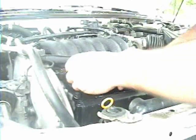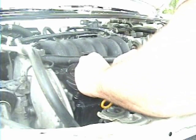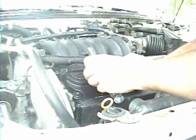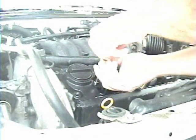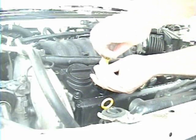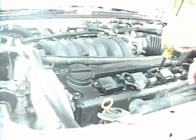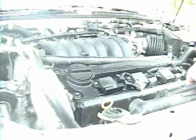So you just go ahead and after you place the spark plug, stick your coil back in, stick your bolts back in. And these don't fit too well, and again, you don't want to manhandle them. This one's even too short for this hole, but it stays in place. You just don't want to over tighten the hell out of it because you will probably strip the threads out. And that's how you change them on the front bank.